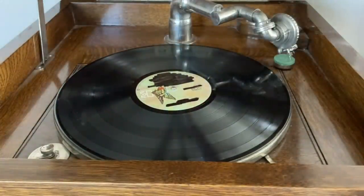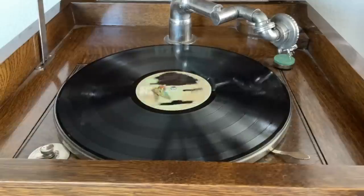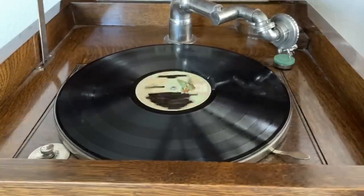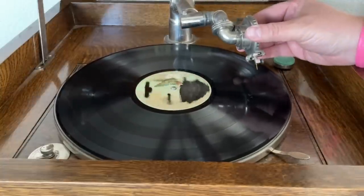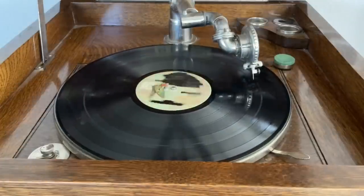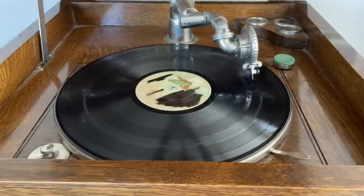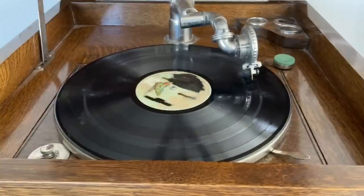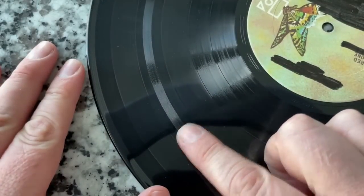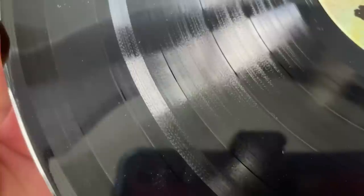Hope you guys are excited because I actually kind of am. Obviously this will be spinning at 78 RPM, which is going to render this kind of cartoony sounding. What's funny about this too is that this is a micro groove record and this is a three mil stylus — the type designed to track a wide groove record like a shellac record. So I'm going to drop it right in the middle of the third track. As we watch the wear ring form, I'm actually surprised it's as audible as it is. Wow, this is really interesting. Yeah, it does not sound good. That right there is what 170-ish grams will do to your vinyl record played with the incorrect stylus. It's absolutely decimated it.